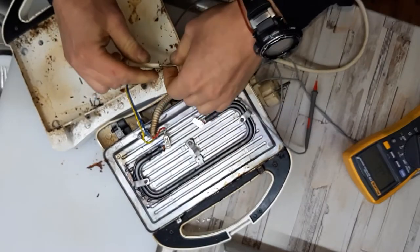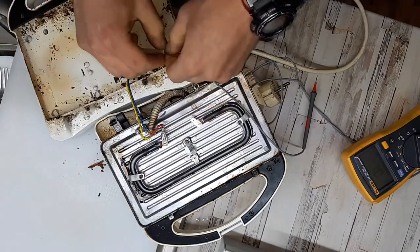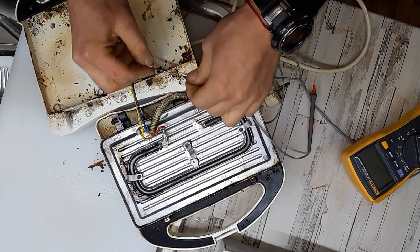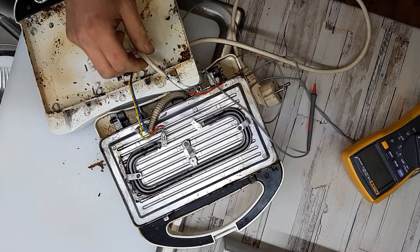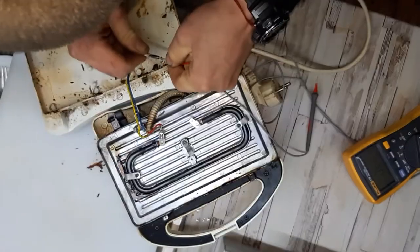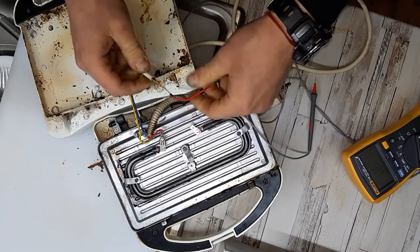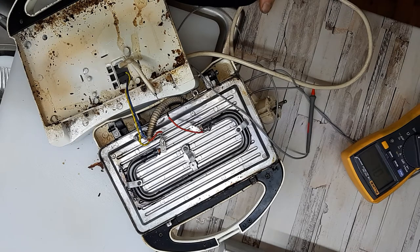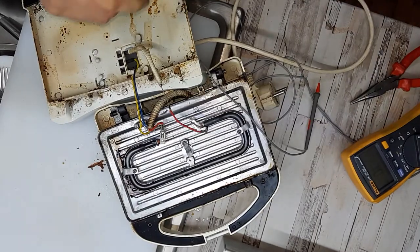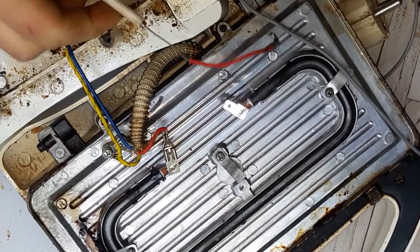Well, not a lot that we can do about it. I don't have another one right here. What are we gonna do? Do I have another one? 250 volts, 240 degrees. It just blew up because they pulled it for way too long. Let's see — I'll just try to find another one. I don't have a thermistor or a thermal fuse or nothing. I don't have it.